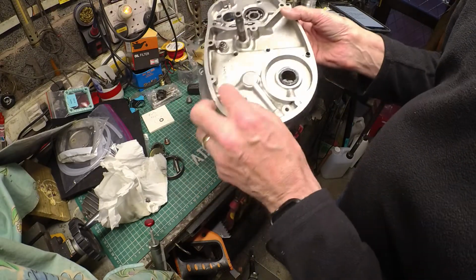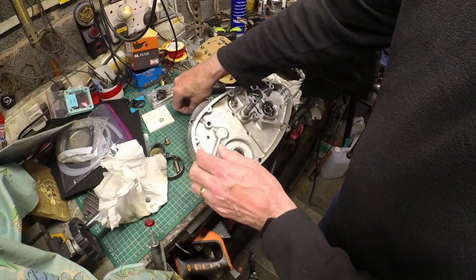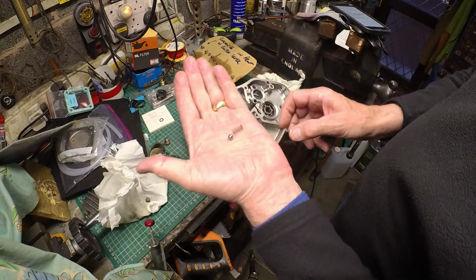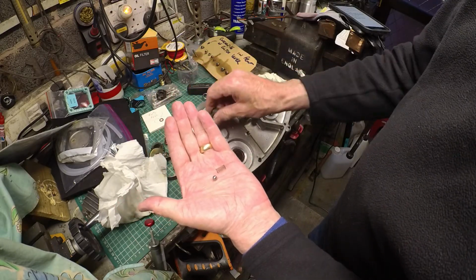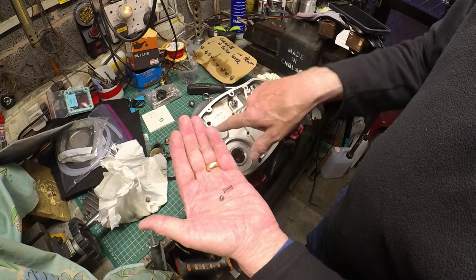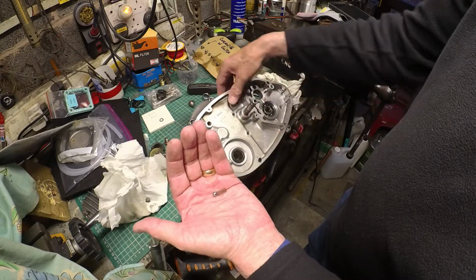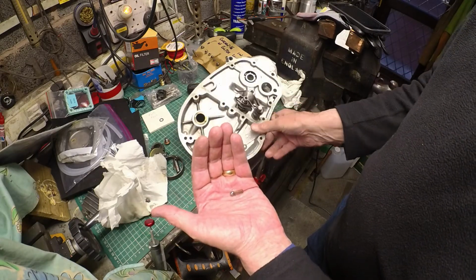which looks okay. I mean, the seal looks okay, but the spring looks to be too short. There's the ball and the spring, which fit in here with this plug to hold them in place. So basically, the pump overcomes the ball on its seat and pushes oil past here into the end feed to the crank, which is, in other words, through here.